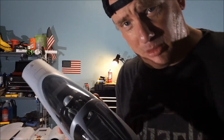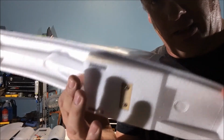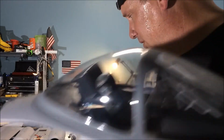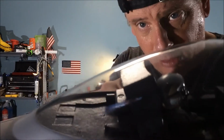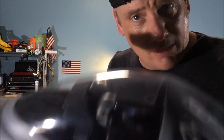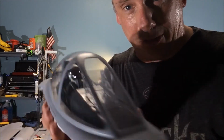There's a couple ways you can deal with this. Some guys talk about cutting vents, which I guess is a perfectly acceptable solution. I think what I'm going to do is go in there and cover all that with aluminum tape, just carefully. Detail that out, cover it with aluminum tape, and then repaint the surfaces in there. Just paint right over the tape, and that way there's no gatoring whatsoever. I may even cut a vent or two, but that's the way I plan on doing it.